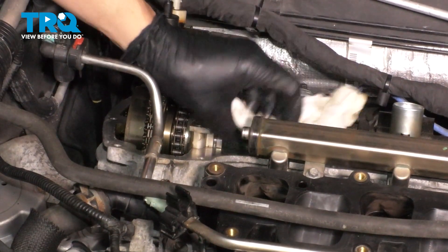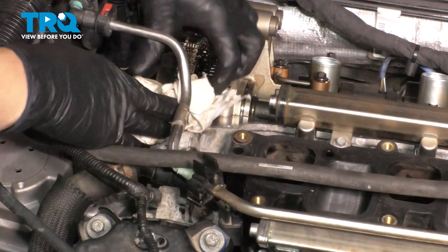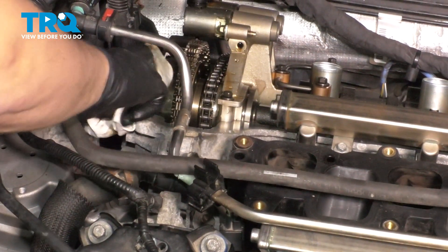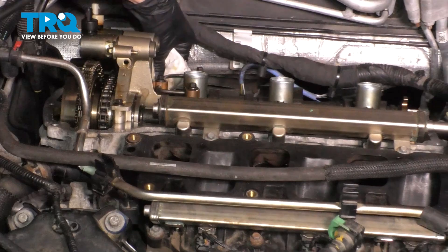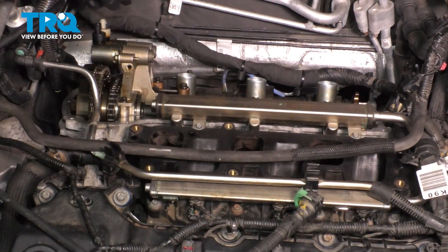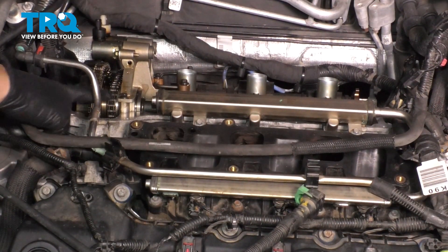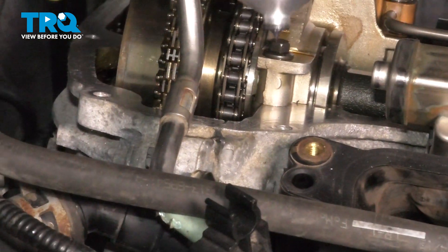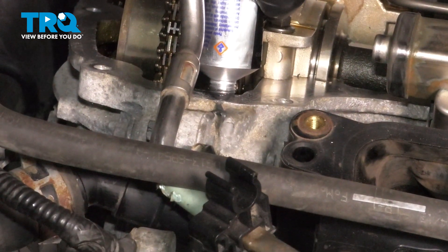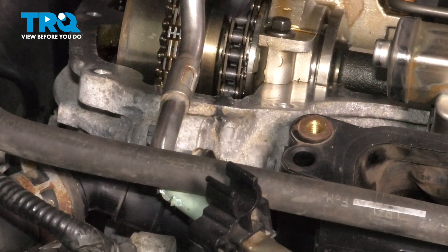I have a rag with some brake parts cleaner — I'm going to degrease the surface. It's important that no oil is here, especially right where we scraped off the old RTV, because we're going to put on some new RTV. It's important that you don't put too much. Grab some RTV — I'm using black because it's oil resistant. Put just about this much — you don't need more than this. Any more will squish out; on the outside it's not a big deal, but you don't want it to get inside the engine. Do the same on the backside. You'll have a symmetrical spot with RTV on the backside right where the timing cover meets the head.